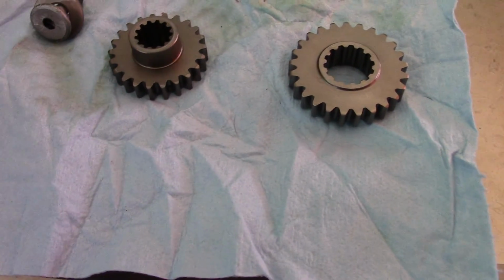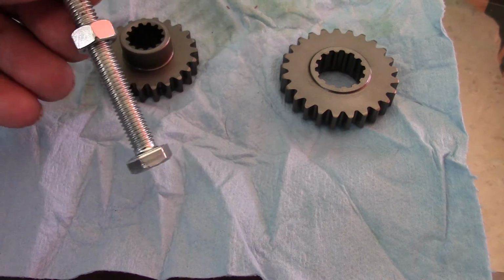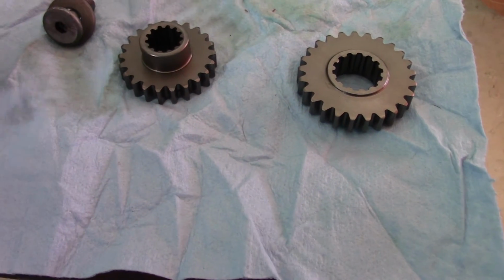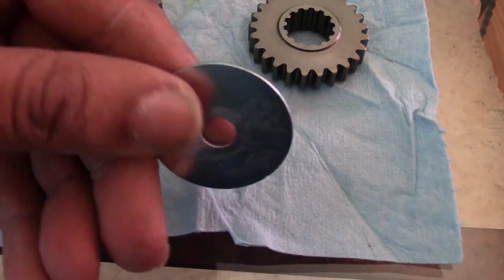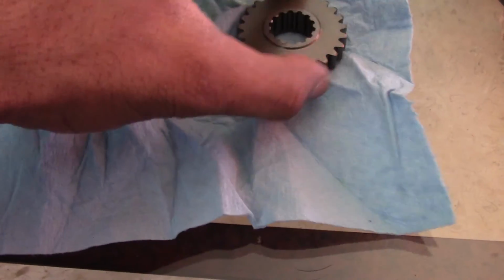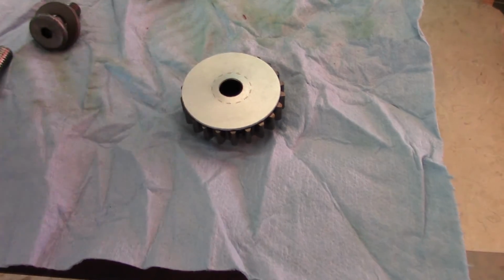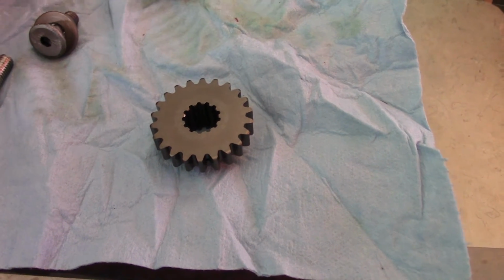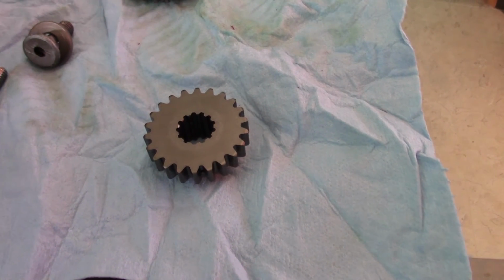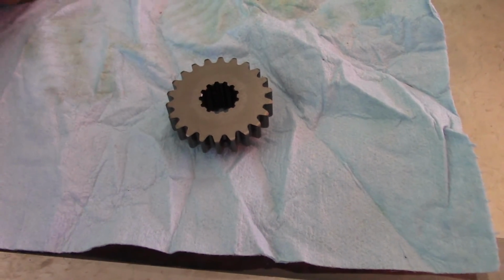used. So this was a M8, I guess by 50, 1.25 pitch with the matching nut, and I got a washer which basically was about the circumference of that lower sprocket, and you know, I was able to push it on the shaft pretty good just using this method, and it got it from a suggestion from somebody on .org. So we'll see how it works out.